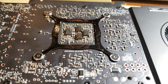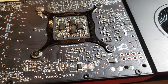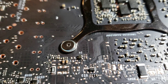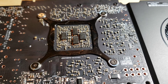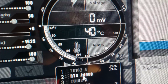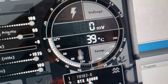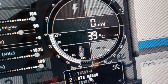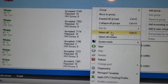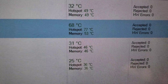Got the back bracket back on there and broke the tip of my little screwdriver. I'm thinking 0.5mm might have been the right size — it was getting a little tough there at the end. There are dangers in doing this stuff. But I'm going to get it in there and see if it immediately overheats if that pad was too thick. That guy's idling at 40°C and I haven't even started mining yet, so I'm going to say it's not making good contact. Of course, I've got to be at work in an hour. Lesson number 423: don't start a project unless you've got all night for things to go wrong. I'm going to hit start on this thing. There it goes — 68 immediately, but that memory is down.